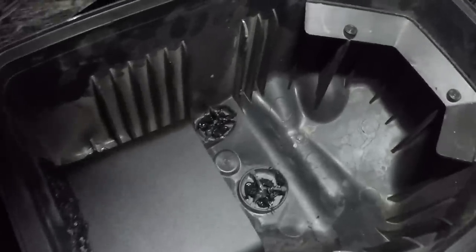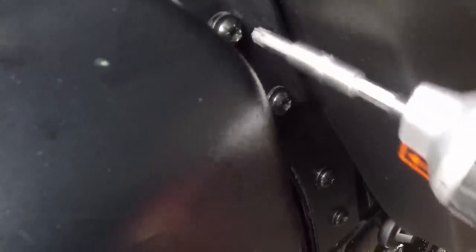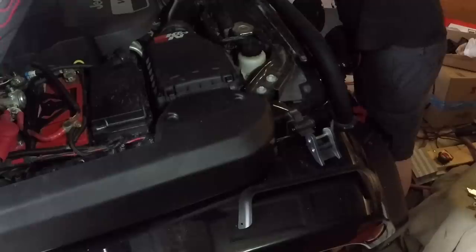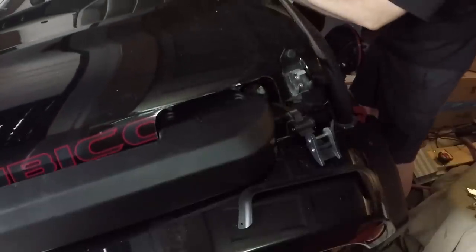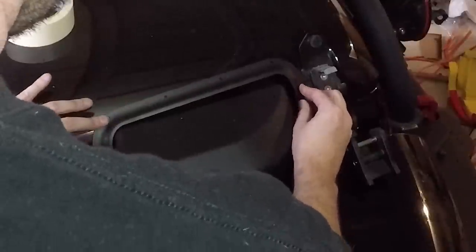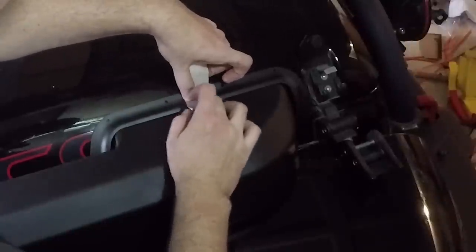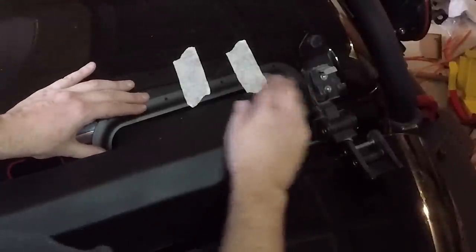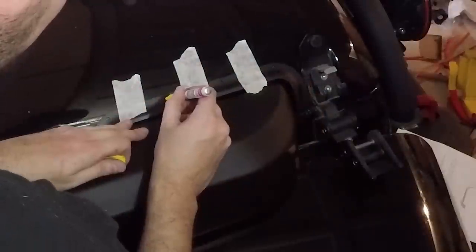Here's a look at the air box covered in silicone — after it sets I'll likely come back and add a little bit more. Now back to the A-pillar bolts. The bottom one caught just with a little bit of effort, but the top one required me to actually push against the wall of the garage to get enough force to make it catch. I switched to hand tools because this is a tight fit and I didn't want to put too much pressure on the bolt head and snap it off. Then lower the hood for a test fit, line up the trim ring, see where it should sit, tape it into place — there should be about a one-eighth inch gap above the snorkel. Mark your holes, prop the hood, and support it for drilling.